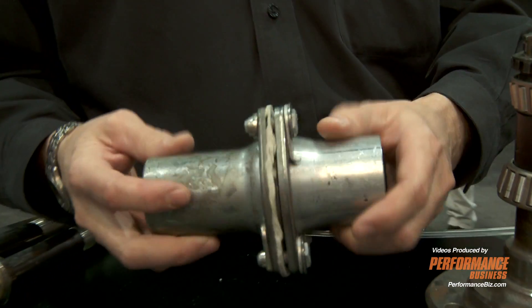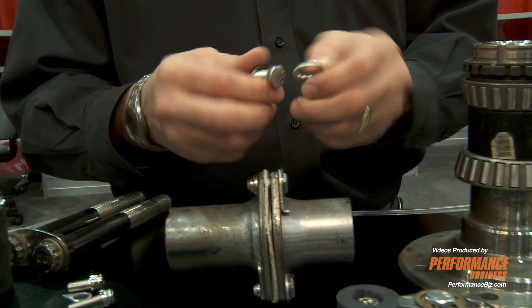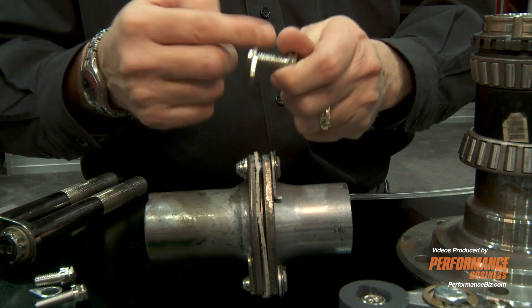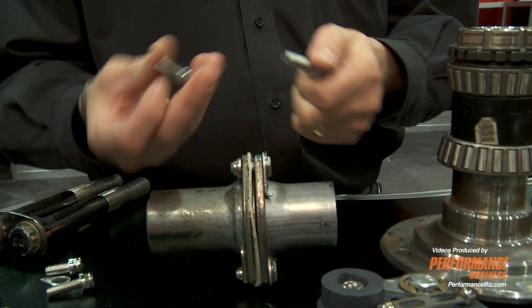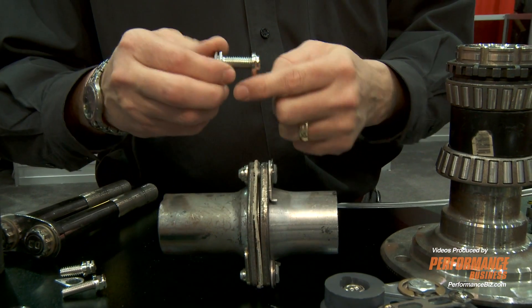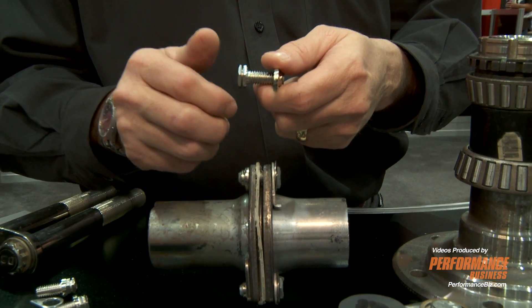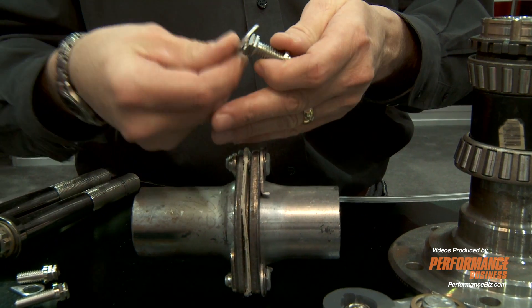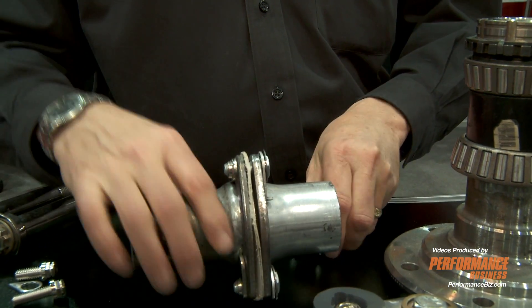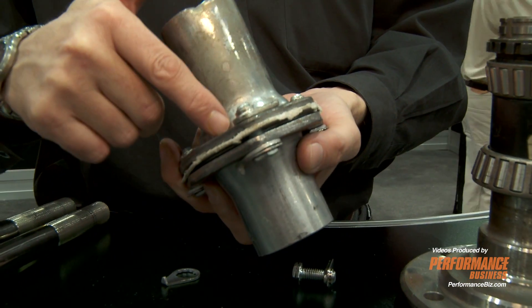This is our collector locking system. We add a piece of hardware to the header bolt system. This is called a weld tab — there's no welding involved, it's just called a weld tab. As you're tightening it, it will spin around and hit the tube on the back, so you only have to wrench one side. Once you get it tightened where you like, you put the retainer on the front side. If you look here on the installed system, you can see the only way that this can turn is to tighten itself.